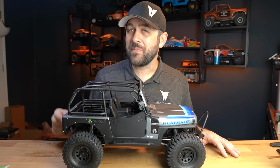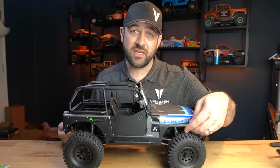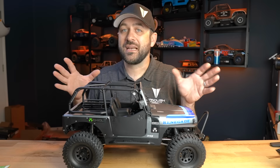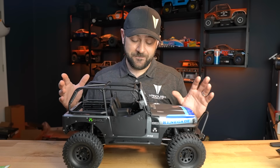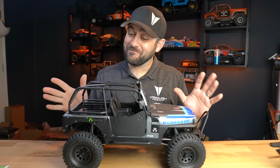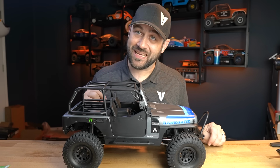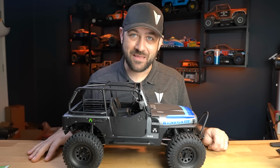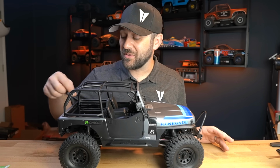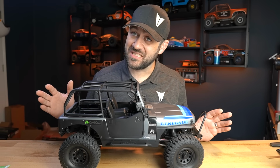This is a little bit compounded, I feel, because of the body armor that's molded onto this and the front fenders being all molded plastic. It takes even less of the ability for the body to flex out and around things. It just makes it a real bear, but it looks really good. So I suggest throw a big battery pack in there and don't take the body off very often. I'd say the addition of a dead man switch, which is where you have a physical battery disconnect somewhere else, may not be the worst idea.